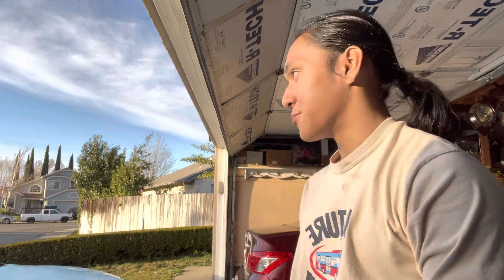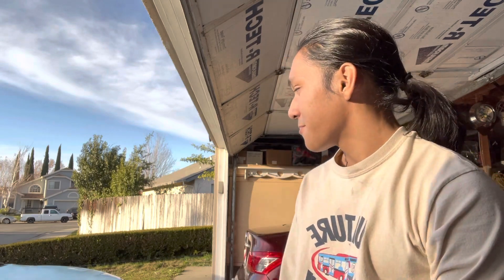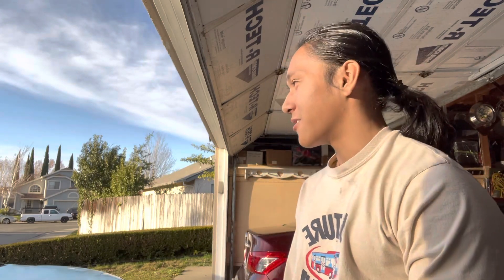I just want to camber it out a little bit — maybe two and a half degrees in the rear and a degree and a half in the front, if it's possible at all. Same thing with the Celica, but obviously wider wheels on both of them. Not really a stretched look per se, but more of a flush fitment.